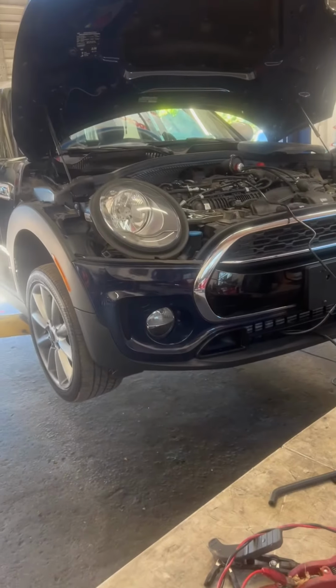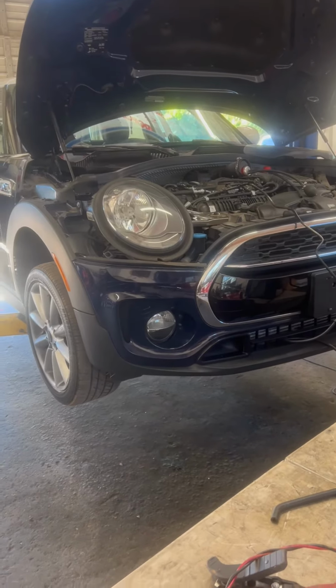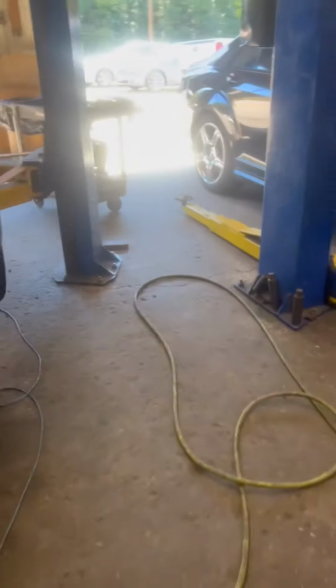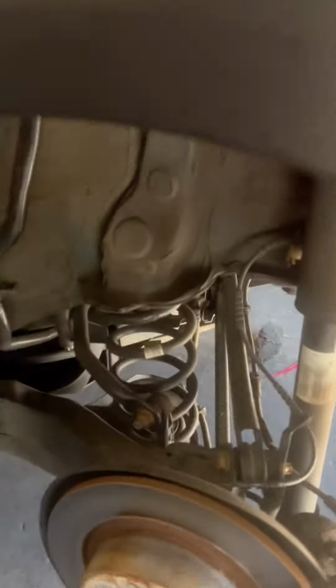Now, just a little history. This car has gone to the dealership twice now, but it's been there before for the same issue, the micro leak. The NVLD, a little pump, has been replaced. Came back on, they took it back and had the DME programmed, the light came back on. So it was asked, do me a favor, can you try to figure it out?